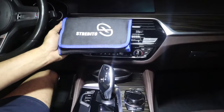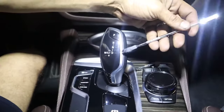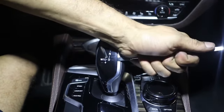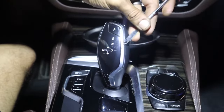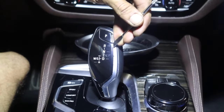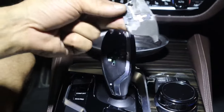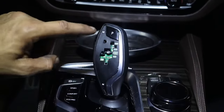The kit has all the basic nuts and bolt removers that you need. On your little tool kit you'll see a metal pick tool — get the sharp side. We're going to pry this plastic piece off. Just go ahead and slide it right behind the glue. Once you have that glue nice and out, you can see it starting to come out. Just put your pry tool behind the plastic piece and pull it off.